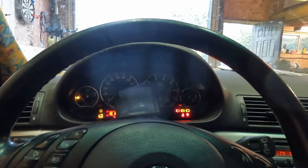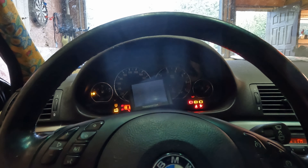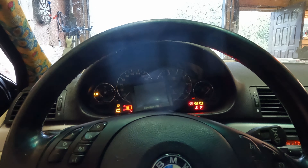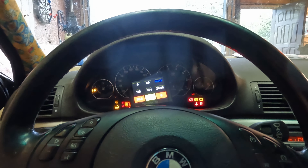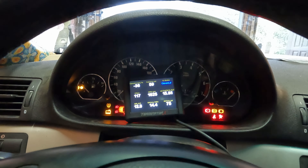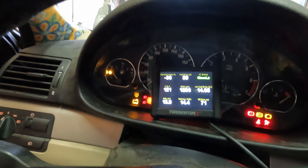We can check to see what's what here. I'm gonna cycle the pump twice, maybe even three times. One more time for good luck. Looks like we got perfect fuel pressure — it was at 70 to 76 before, and now we've got 59, as you can see on the screen there. That's freaking awesome! That's really awesome.